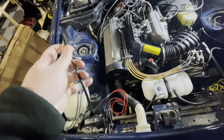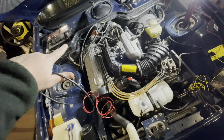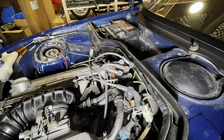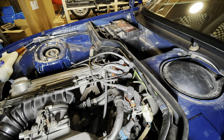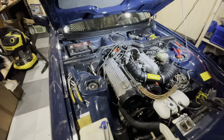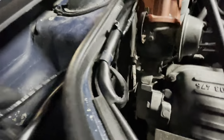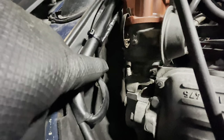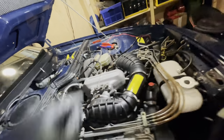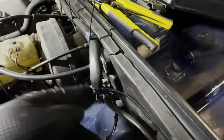So what I've done now is I've made a wire and wrapped it in butyl tape — two live wires coming directly from the battery. I'm going to get that through the bulkhead and route it along here. I now have the little wiring harness sitting here; it'll go onto the battery over there, coming through the firewall bulkhead. I've got it with tie wraps and it's running behind the distributor all the way across and then out along the wiring harness down here.